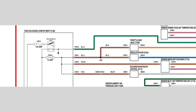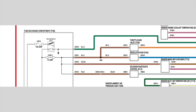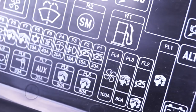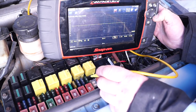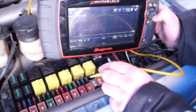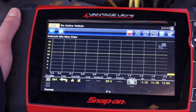This is going to make a difference to the vehicle running. We have fuse two in the engine compartment fuse box — F2, a 15-amp fuse — next to F1, a 30-amp fuse which is ECM-related. We're going to test this fuse now. On fuse one we have a reading of 12 volts. On fuse two we have power in, but on the out — nothing. So the fuse has blown. Just to confirm: this is a visual blown fuse. We now have 12 volts restored to the mass airflow and 12-volt supply to the hot wire, however this will not be the cause of the engine not starting.